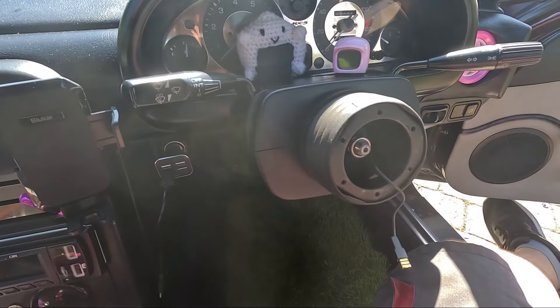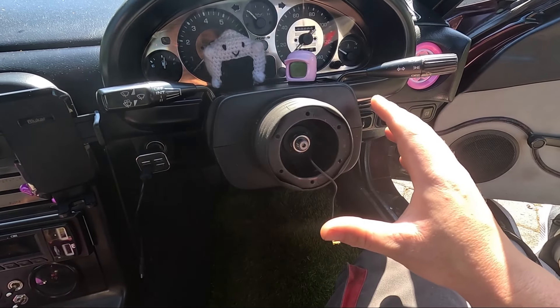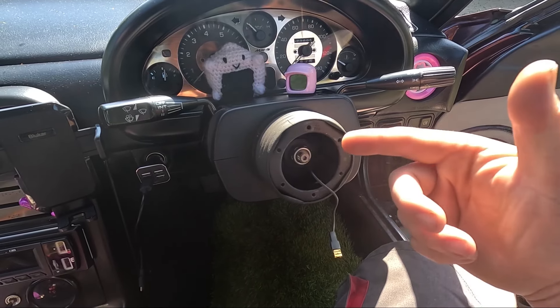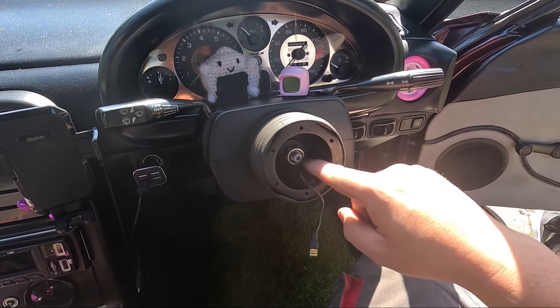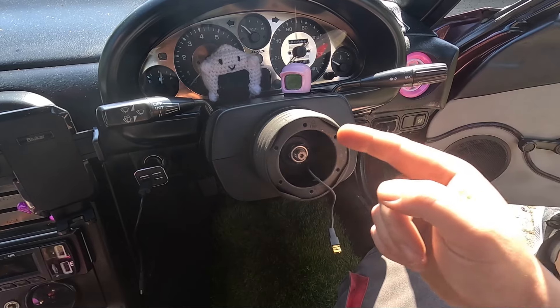This is where it's going to vary a little bit. If you've got a standard steering wheel, it's still going to be on at this stage as the standard one isn't a six-bolt steering wheel pattern. But if it's a special edition or aftermarket, you'll be at this stage. With a standard steering wheel, once the airbag or horn is out of the way, you'll get access to the big nut — which is a 21mm.